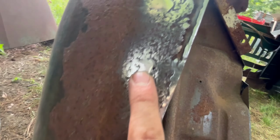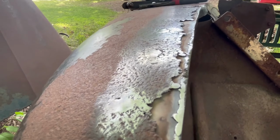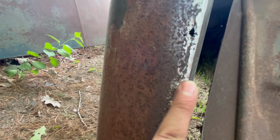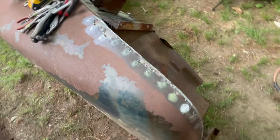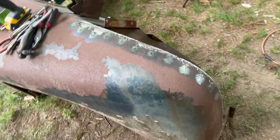And like I said, I went back and I plug welded all of the spots, and then I ground those plug welds smooth. So it's nice and round. No dents, no warps, no nothing. Pretty solid. There is some thin metal down here, but I think I'm just going to leave that for now. If I need to, I'll pop it back off, because it's going to be able to come on and off easy enough. So, yeah, that's this side. I don't know if I'll get to the next side in this video or the next video. This took me pretty much all day to do this one.